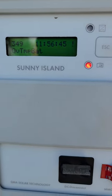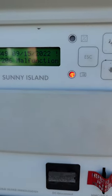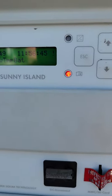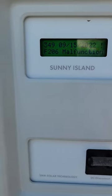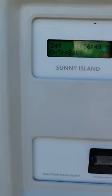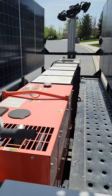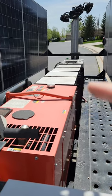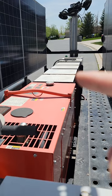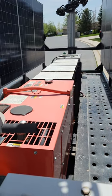This video is about the over-temp malfunction — the over-temp battery sensor. You can see this trailer is actually having this issue. The battery is sitting in the sun, soaking up extra heat. If you stuck a thermometer in there, you'd see it reads hotter than it really is, because the metal is radiating that heat down.